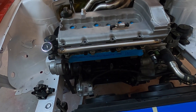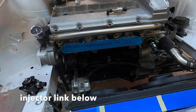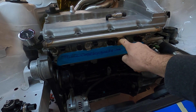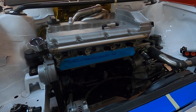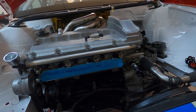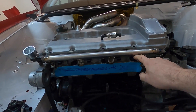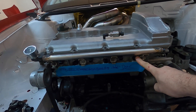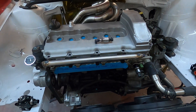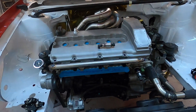I'm going with staged injection. I found injectors used on a Porsche 997 — they're the same length and have an extended tip just like the factory ones, so there's no need to space the rail like with the Deka injectors I had before. They take a different plug but I already rewired the harness for that plug on the last car. I'm running 627 cc injectors in the head.